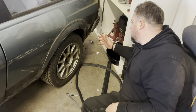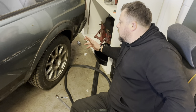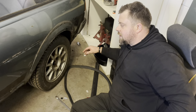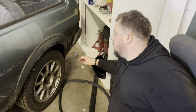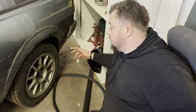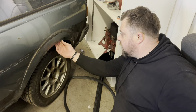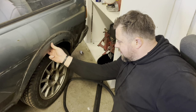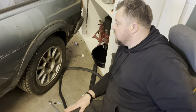We've got a couple of choices here. This obviously isn't going to be a survivor car anymore — the roof's been damaged and we're going to have to repair it. This quarter panel is going to need repair and I'm pretty sure the other side is going to be exactly the same. Repair panels are the easiest to get for these. If we're going to do a resto-mod and put some nice 15-inch wheels on it and make it a wee bit lower, I say we just cut the rot out, weld the two skins together and plate it. That gives us a higher tolerance to run it lower, so we can put a wide fitment wheel on it. It'll never be a ten-grand Scirocco thanks to the roof damage — it's not really a collector car — so I think we just make a really cool resto-mod Scirocco.